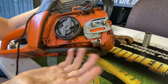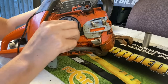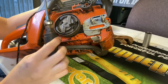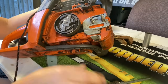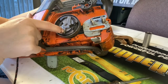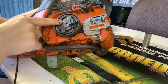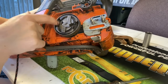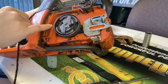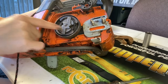The prong tool has a nut for the socket so you can use your impact if you'd like. But if you don't have that tool, once you've locked the piston in place, we're going to actually tap it off using a hammer and a flat head or standard screwdriver. Whenever you do it though, you only want to tap on this center piece, because if you tap on the other parts down here, they are loosely held in with a spring and the whole thing can fall apart. We want it all to stay together, so only tap on this center piece that is threaded onto the crankshaft.